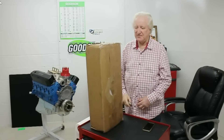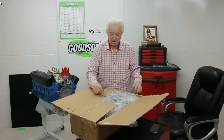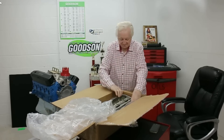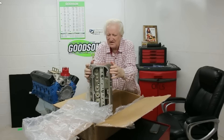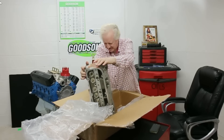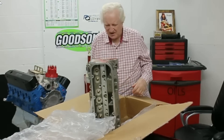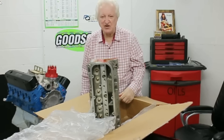Okay, the moment of truth. Let's open this packet. Well, at least I can see it's a cylinder head. It's a dark cylinder head — pretty trick-looking cylinder head. It's a nine-degree raised port Dart cylinder head. It looks like they are kind of roughed out, new seats in them, doesn't look like they've been used. They are nine degrees on a 4.4 bore center line.